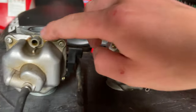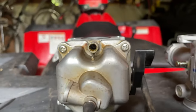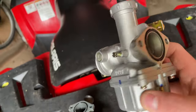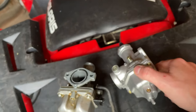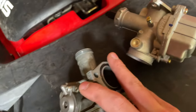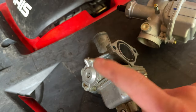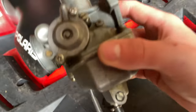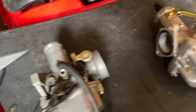Wait — is there supposed to be a jet in there? Because this new one doesn't have one. The old one has something in there — that might be why it doesn't run well. Honestly this doesn't look that bad quality-wise now that I'm really looking at it. It looks almost identical — this one has a vacuum-controlled diaphragm and the new one doesn't. I did check all the diaphragms to make sure they weren't cracked, and they're all good. Something tells me the diaphragm difference has something to do with the running issues.